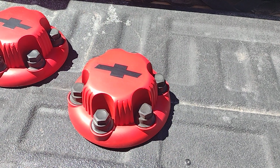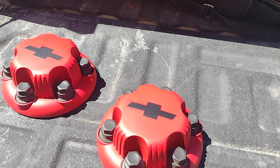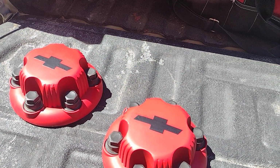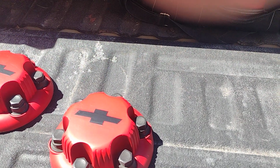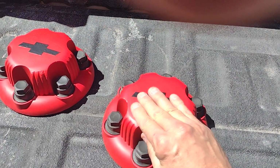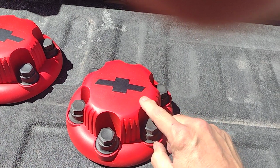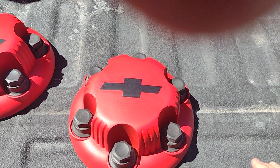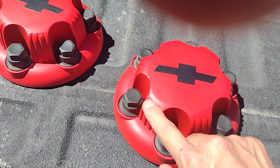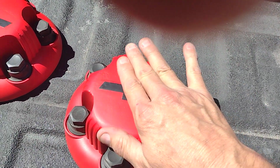But that hardener did not last, so I used the hardener that came with the fiberglass filler. When I mixed it in, that hardener was blue, so I got a bluish mix. Put it on here. I sanded this down, of course, using my orbital sander, my handheld palm sander, a Craftsman. Any excess, I was able to just pick off. And then you can see the finished result.